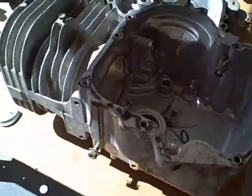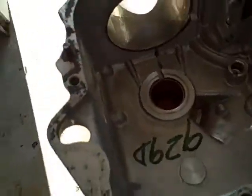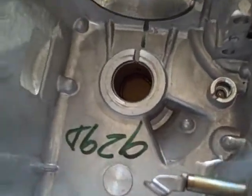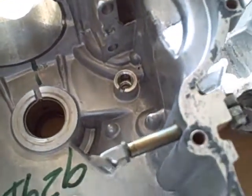Everything's now clean and let's take a look at what we've got. The cylinder is actually in worse shape than I thought — we have some real problems here. I mentioned earlier that crack we have, right here. But when you look at this closer, there's other things going on. The inside of the cylinder wall right here is missing a big chunk — all right here, that's all completely gone.